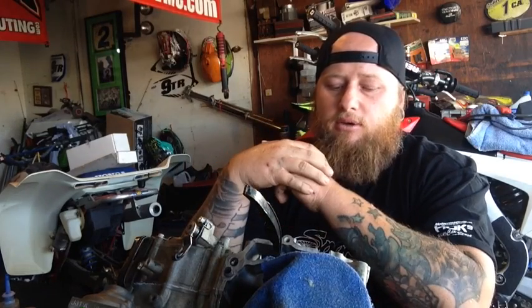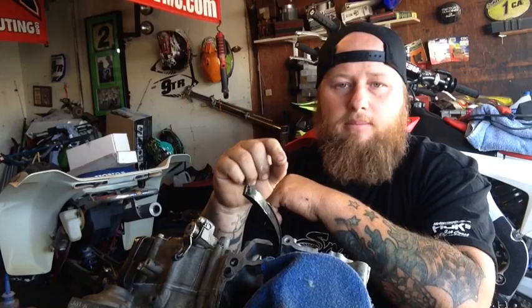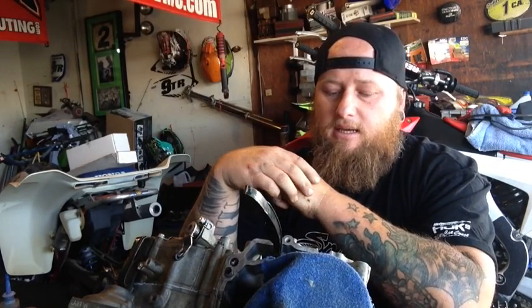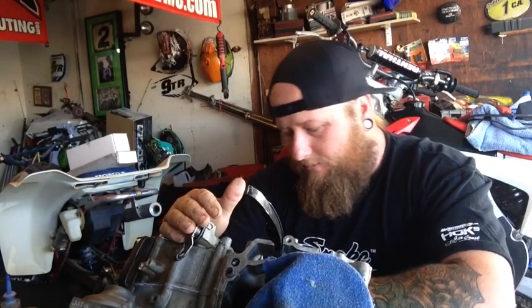If you're assembling an engine and you've already spent a lot of money putting these things back together, it is absolutely worth it to wait a couple days, get onto RockyMountainATVMC.com or BTOMotorsports.com, and order yourself a pin sleeve, even if it means you're going to miss a race that weekend. To me, they're $1.70 something to $2.15, and the damage that it can cause by not having them is way worse than waiting an extra 2-3 days and then being able to ride.